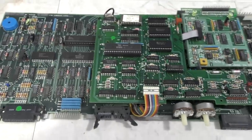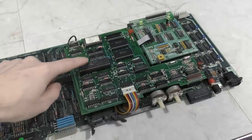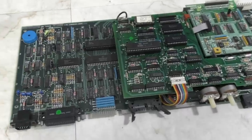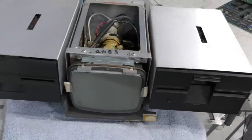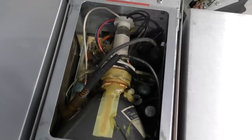Taking a look at this board, you may notice this large daughter board. This is actually an aftermarket product that gives the Osborne 80-column video. The other small daughter board is another add-on from Osborne itself — a double density floppy controller. The early models could only use single density disks. I'll just deroute this floppy ribbon cable and remove it. And now I'll give you the first look at this tiny little CRT. It's quite long compared to its viewing area.